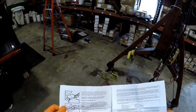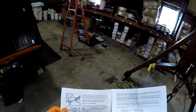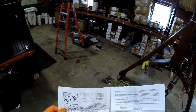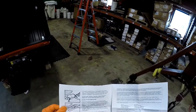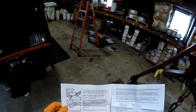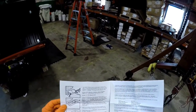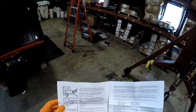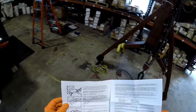With a squeegee supplied in kit, apply maximum pressure as you affix the pad. Carefully avoid wrinkles, creases, smooth the entire pad to the surface. Attach the first length of AC cord with a cord tie supplied in kit. This prevents the weight of the cord from pulling down on the pad. Plug the heater in for 5 to 10 seconds. Unplug and squeeze the pad again. Do this twice.